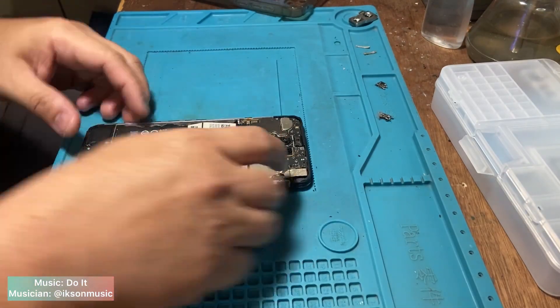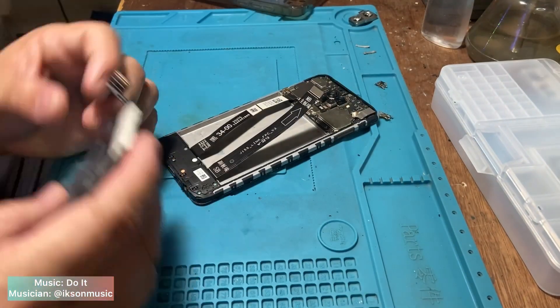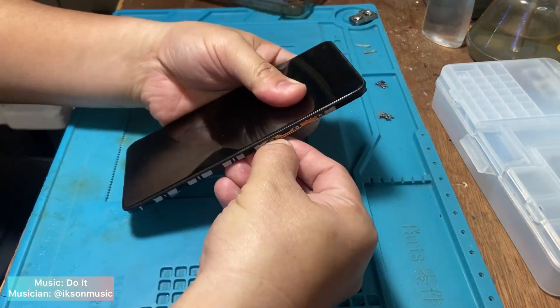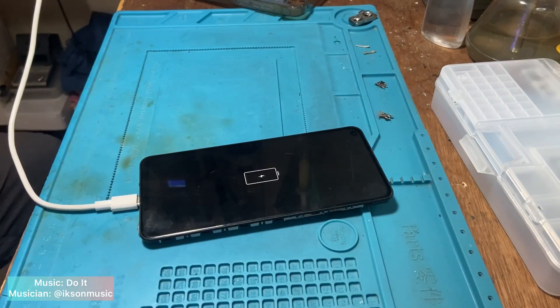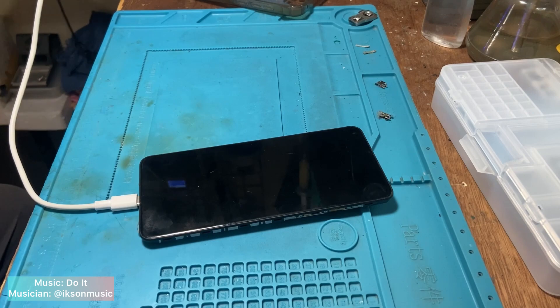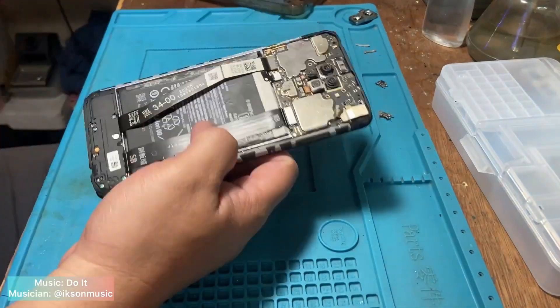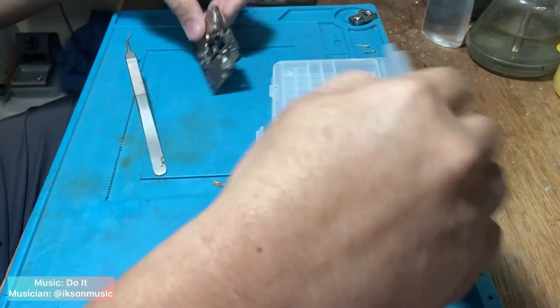Hi, I'm SCJ Repair Shop. Today we have a Redmi Note 9 with unstable power. The owner tried to bring it to other repair shops to fix the problem but it failed. You can notice the battery management system has been repaired — other repair shops tried to solve the issue by changing the BMS of the battery, but the problem remained. I checked all the voltages and resistance of all the resistors connected to the battery ID and battery thermistors.